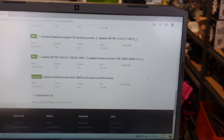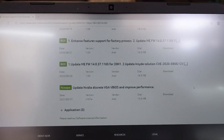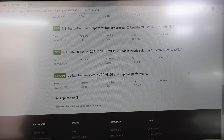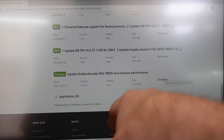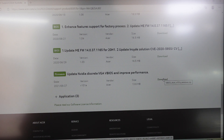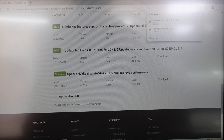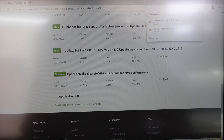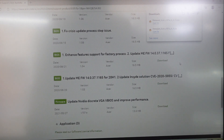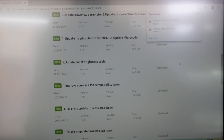If you like a free performance boost and you've got one of the new Nitro 5s, Acer have actually been fairly active with BIOS updates and vBIOS updates, which is very handy. The vBIOS on mine was typically running at 80 watts, and I've been reading — and a few people have told me — that there's been an update of the firmware or vBIOS for the 3060 to run at 85 watts.